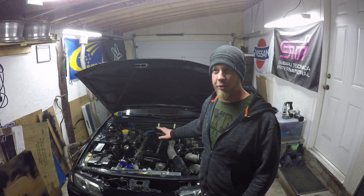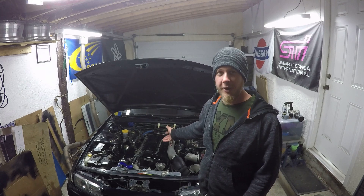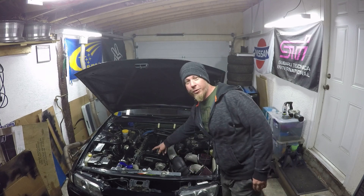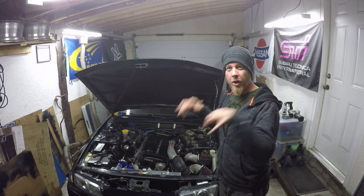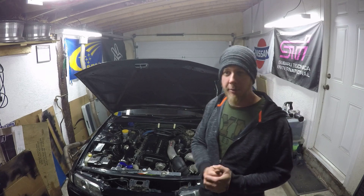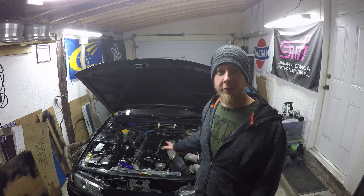The job is very similar to two videos ago when I had the ignition out of my RB20. The RB26 is extremely similar, almost identical — the parts are interchangeable. So it's just a bunch of Allen screws on the top ignition cover and the igniter. All that stuff comes out of the way, then the coils and spark plugs come out, and then I'll grab my compression gauge and leak down set and go through each cylinder. Before we do that we want to start with a warm engine, so I'm going to run the car for a bit to make sure it's up at operating temperature.